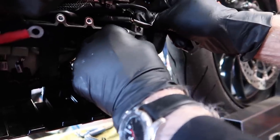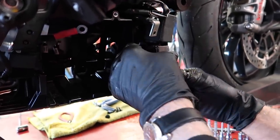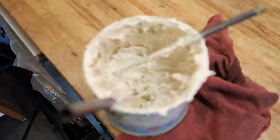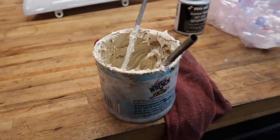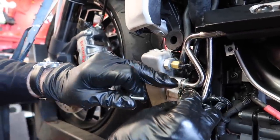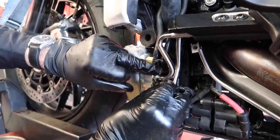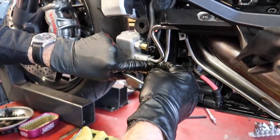We can put the fuse boxes back in here — just pushing those guys in. Fuse boxes always scare the crap out of me. I like them to be happy in their place and tidied up nicely. Next we can finally put the oil cooler back on. He was adding some grease there. Got the oil cooler back on and attached. One thing he mentioned is whenever you attach this piece up here, make sure you pre-twist it so the lines don't get tangled once you screw it in. He also lubed up all of the rubber pieces and the O-rings, which you always want to do with oil.